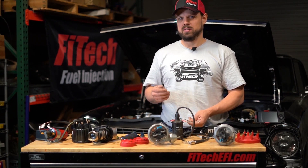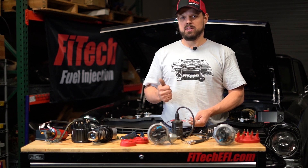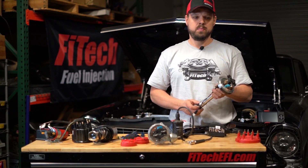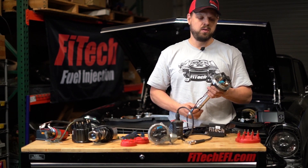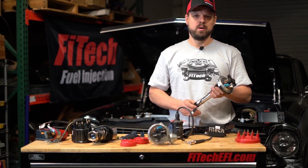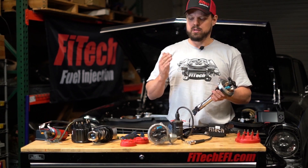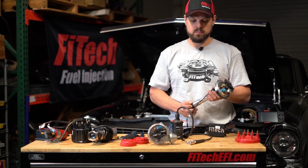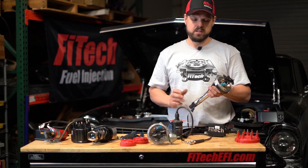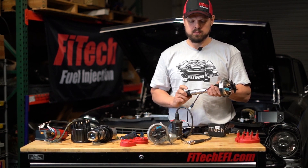The purpose of ignition timing control is to deliver the spark to a cylinder at the right time. If the spark is not delivered at the right time, side effects could include ignition knock or very poor efficiency — and if it's completely at the wrong time, it won't ignite at all. At cranking speeds, the coil begins to dwell when the tooth passes the pickup and then fires a few degrees afterwards. At cranking, we also do a multiple spark — after the first spark, there's a short delay and then a second spark is generated. At higher speeds it'll just be single spark.